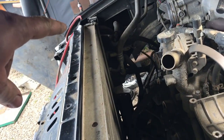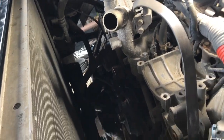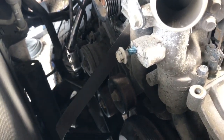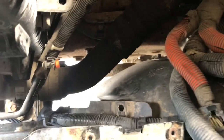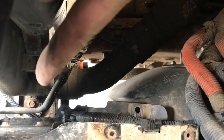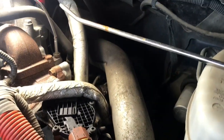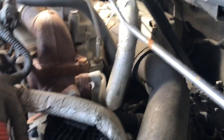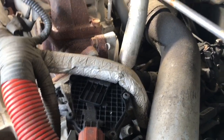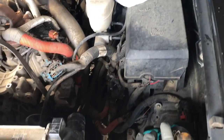The cover comes off the top of the radiator, then the fan pulled off all the way and just slides out the top. Sticking the bolts back in the holes so I don't lose them. Working on down there — you can see that one there is the clamp for the hot-side air-to-air. We'll pull that out of there; that air-to-air pipe goes right up there. The turbo is behind there. We'll make a little more room and then see what else we've got to do with this wiring, because we've got a bunch of wires coming up off the engine that don't terminate here — they go into this box. That's the next thing to figure out: how many wires we've got to pull out of the bottom of that box.